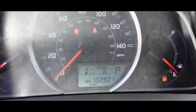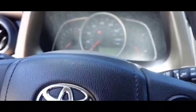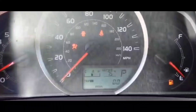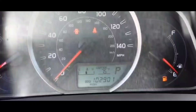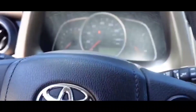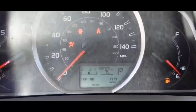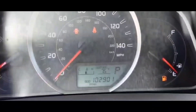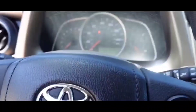I was scratching my head and started checking the battery to see if it was any good. I turned on the headlights to see if the lights were bright, and they were. I remembered changing the battery out a couple of months ago — bought it from Walmart. I checked both the positive and negative connectors to make sure they were clean and tight, and they were. I also checked the ground wire — it was 100% connected to the frame with no rust. I was really stumped.